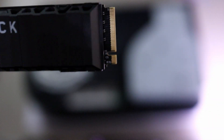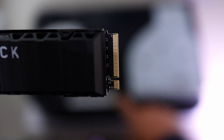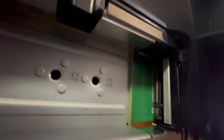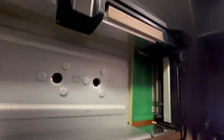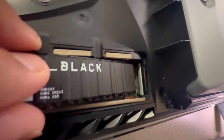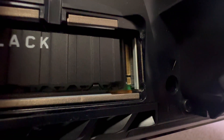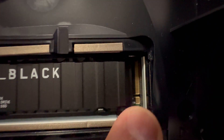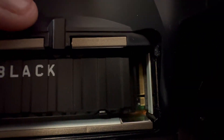This right here — that right there, you're going to see it in the slot. Now, once it's in there, that's how you know you're going to put it right. You just line it up with the one that's in the actual PlayStation. You can't mess this up, all you got to do is pretty much line it up. So here we are inside the PlayStation — the tooth right there. We're going to grab our SSD. You see right there, everything's lined up. There's a gap — the gaps, everything here is lined up. The gaps line up and then you push in.